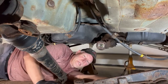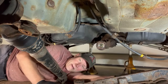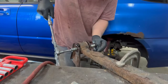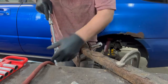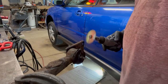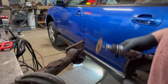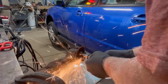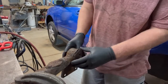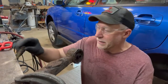To be honest, the t-bar is really not that hard to get out — I had some issues with rusted bolts, but if your bolts aren't rusted, it's actually pretty easy. Unfortunately this thing was rotted on here so bad that I wasn't able to get it out, so I'm going to have to take a cutoff wheel to it and just cut it out and get a new bolt. I was hoping to reuse the old bolt, but so be it. Ends cut off and out she comes.